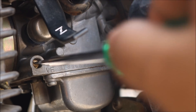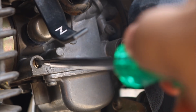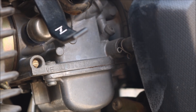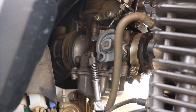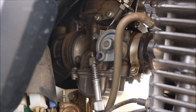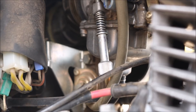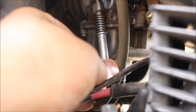Make sure you do this when the engine is hot. Now, why might this exact setting not work for everyone? The answer is that a slight adjustment in the carburetor is needed with the change in altitude and air density. Along with this, the condition of the air filter, type of spark plug, and condition of the engine also play an important role. Now coming to the other end, you have the idle adjustment screw which controls the idle RPM, and above it is the throttle control mechanism connected to the accelerator. With the change in the air-fuel mixture, you might need to adjust the idle RPM with the help of this screw.